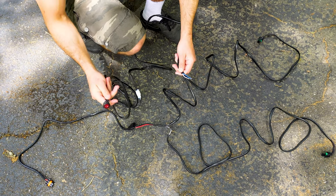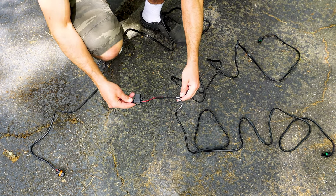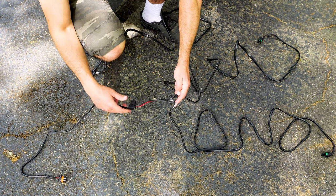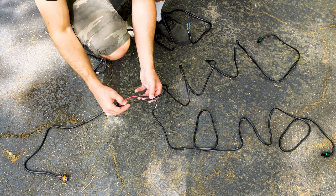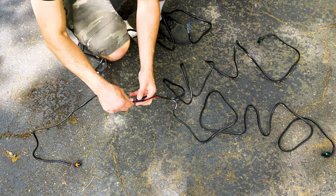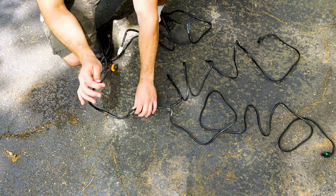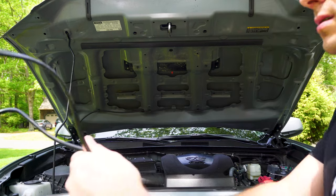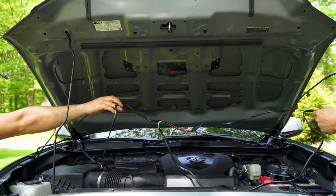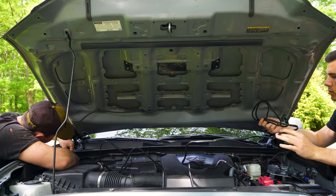We're not going to be using the switch, so we cut that off. It also has a third fuse in the circuit — we're definitely good with that but just to be safe we left it on there. You're going to splice these back together; we used a little bit of shrink wrap and wire tape. This is then going to be spliced back to your Trigger and connects back to the Trigger wiring harness. We're going to lay this across — this one goes to the Trigger, and we'll take this to the driver's side.